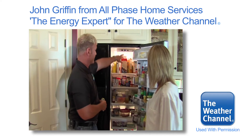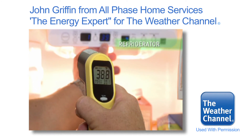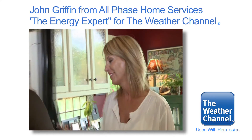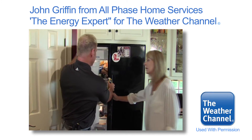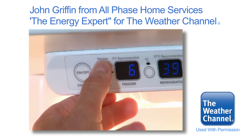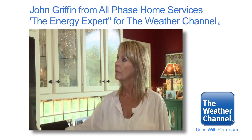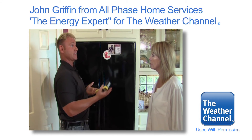Your fridge is set at 39 degrees — 39 is about normal, standard is 40. We'll take a temp in here — it's 39 degrees, so that's good. Let's take a peek at your freezer. Your freezer is at one degree. One way to save a little bit of energy is to power this thing up to the max. Most refrigerators won't go below eight, but yours goes to six. The difference between powering it at one degree versus six degrees is probably somewhere between $10 and $60 a year in energy savings.